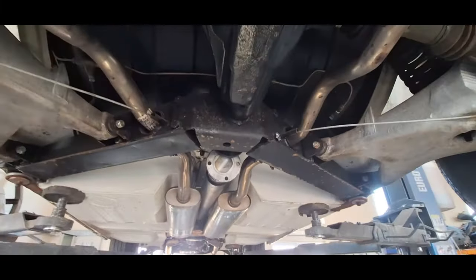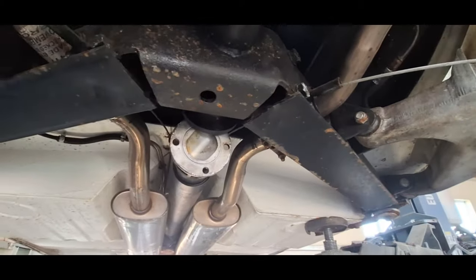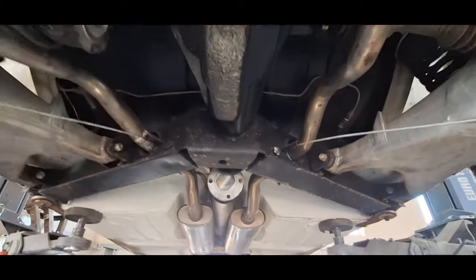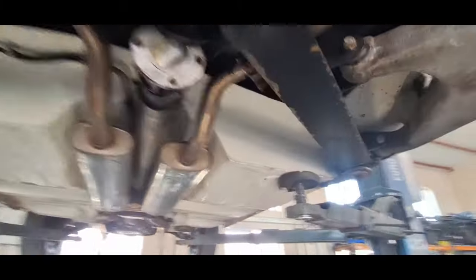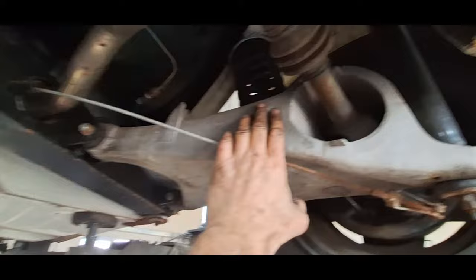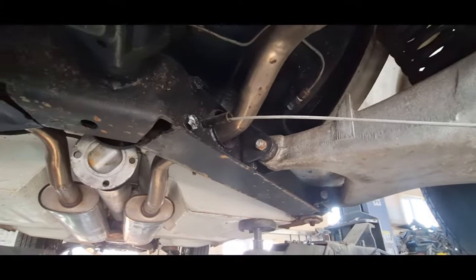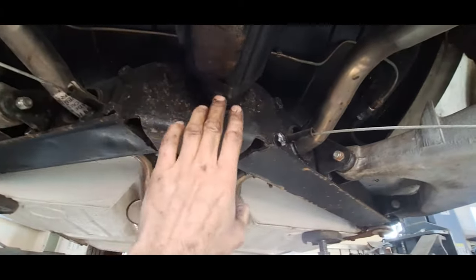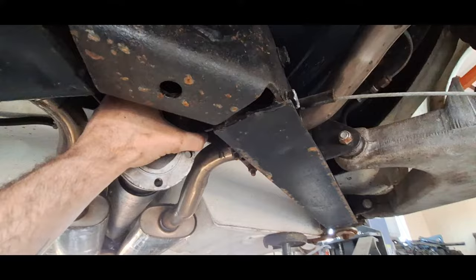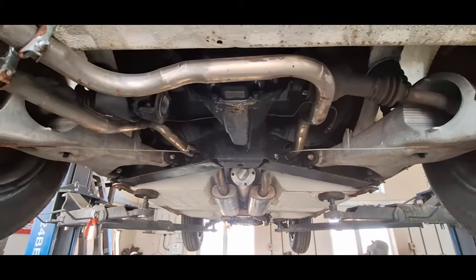I'm hoping to pull the diff out without dropping all the back suspension right down - hoping to let these swing low, exhausts out, handbrake cables and things like that. Having put the ramp arms under here, I can let these beams swing down a bit under spring pressure and that should push it down far enough to hook the quill shaft over the top. I may let the differential come off the quill shaft first, but I do want the quill shaft off because I've got a replacement bearing to put in there. There's no play in it whatsoever, but while you're in here you may as well do it - better safe than sorry for the price of a bearing.